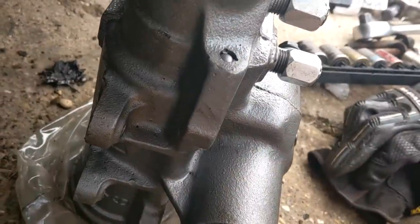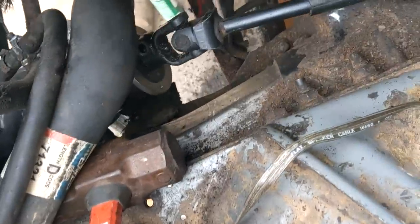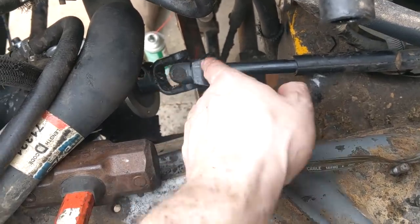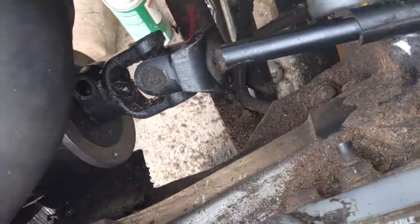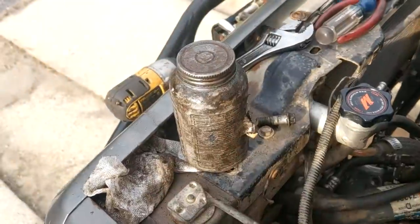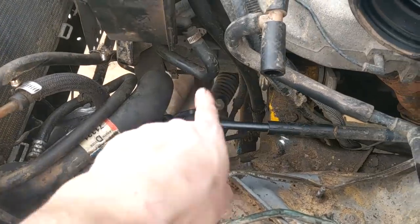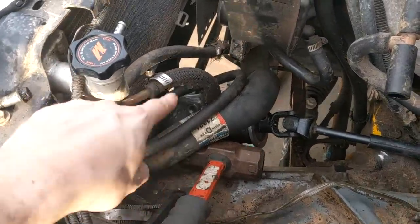There's that thing I was talking about, whatever you want to call it. Time to lift. I've got the box hoisted up on the sway bar. The fun part is making sure the flat lines up — I just kind of lined it up and tried to pull the box forward and angle it. Eventually I had to start beating on it right here to force it on because I finally got it to kind of line up, but lots of rust made it hard to force through. I also made sure to anti-seize it, so next time we have to get it out it might actually come out. I've got a feeling it's not fully seated — we'll probably have to back it out a little to get our bolt through.